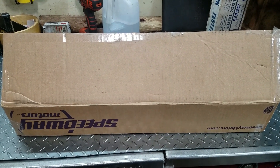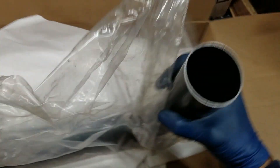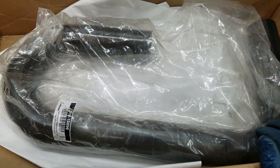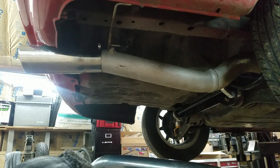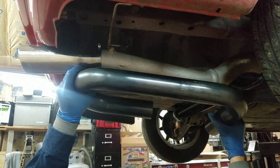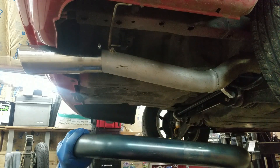I'm going to try to get this noise to go away by building a side branch resonator. I just got a mandrel bent two-and-a-half inch pipe. Apparently you should use the same size as what you have. I have three inch exhaust but it's really expensive, so I'm going to try to do this with a two-and-a-half inch chunk. Basically what this does is it takes the frequency of the drone and makes it travel up this pipe, then I put a stop on the end and the noise travels back down into the exhaust to cancel out the frequency causing the drone.